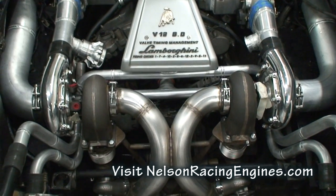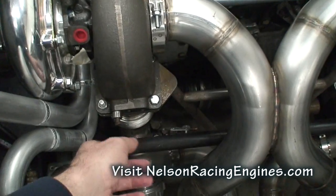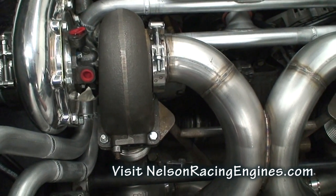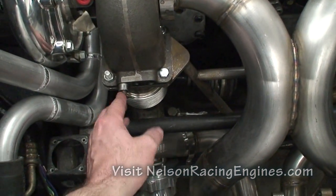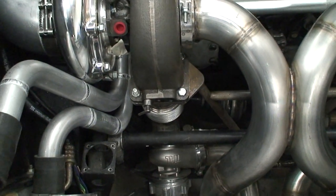Some special things we've got are our patented mirror image turbos. This is one of the very first turbos with our variable geometry design, where it actually shuts half the turbo off. The blade is cast into the turbo itself, and there's a valve that switches on and off based on boost pressure.